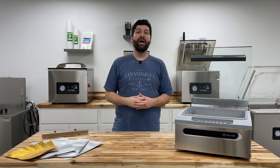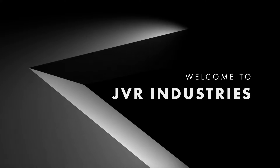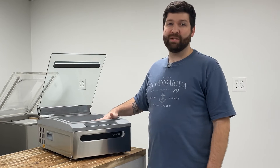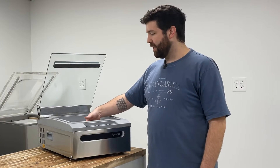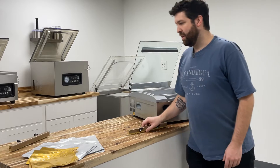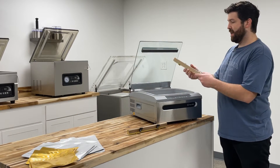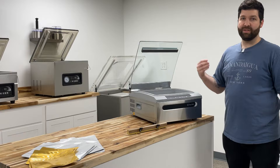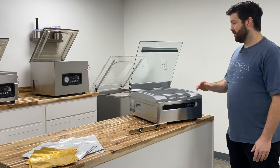Let's get into how to use your retort bar assembly. We'll start with basic setup and installation. The standard seal bar assembly is what comes in your JVR Vac 100 chamber vacuum sealer. Go ahead and put your hand in the center underneath and lift up, and you're ready to install the retort bar assembly. Grab it, make sure the bag clips are on the outside of the chamber, then just drop it in. Align the holes with the seal bar lift piston rods and you're set to go.